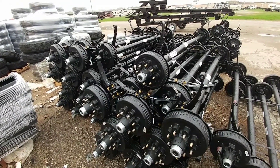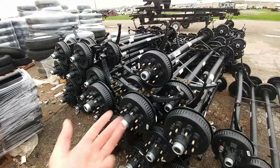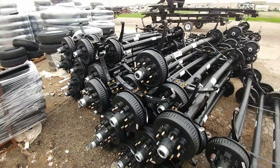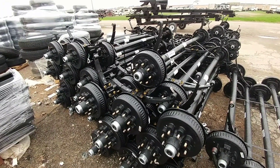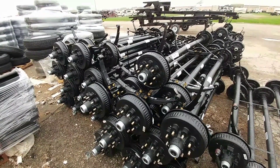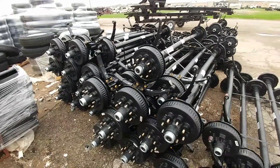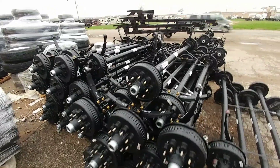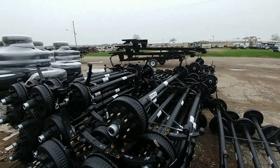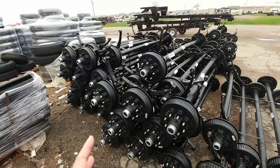A question I get asked all the time is: why are certain axles on certain RVs? If you have an RV with a 16,000-pound gross vehicle weight rating, why would you put 7,000-pound axles on it? Of course, two 7,000-pound axles equal 14,000 pounds. But keep in mind that you really only have about 65 to 70 percent of the weight on the back axles at any given time. When you fill your trailer to its maximum GVWR, you're still putting about 20 percent of that weight on the back of the truck. If all the weight of a car or SUV were on just one axle, you'd be overloading it — and the same principle applies to RVs.